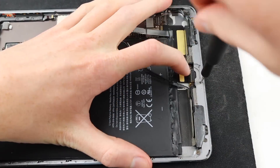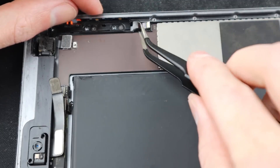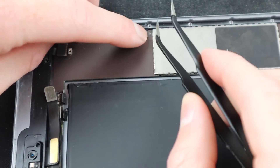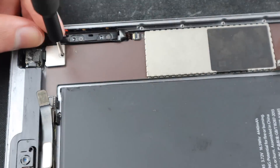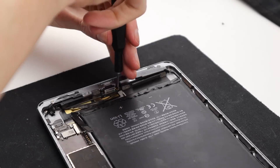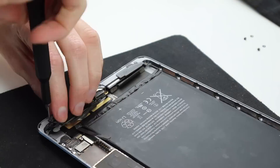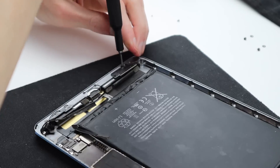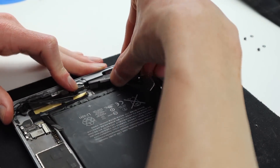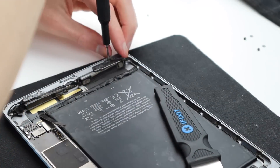With those screws installed I can reroute some antenna cables and begin plugging in all of the connections for various parts of this iPad. It's always a good idea to test out the iPad before you seal it back together — this just verifies that the iPad is fully functional before you assemble it. I noticed that I installed the speakers incorrectly, as they have contact points that connect to the dock connector. I had installed the contact point underneath the dock connector so it wasn't making any connection and therefore the speakers weren't working.